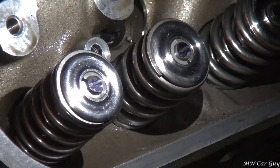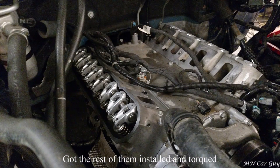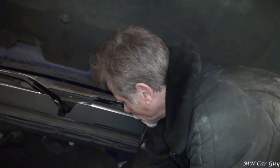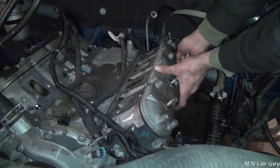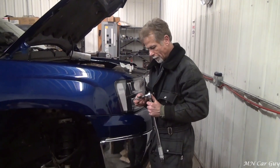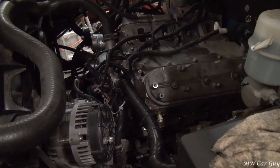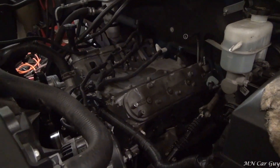I'm happy with it — it's not something I'm uncertain about, I'm genuinely happy with it. It turns out we did not need the spacer for the valve cover. We had read in the forums that they were running these rockers without those spacers and not having any issue. We verified it by installing the valve cover and rotating the engine over a couple of times — there was indeed no striking of the valve cover. Now that we've got those valve covers installed, pretty much all that's left is reinstalling the intake, headers, wiring harness, and buttoning everything up. We'll give you a nice time lapse so you can enjoy our hours of labor in about 30 seconds.